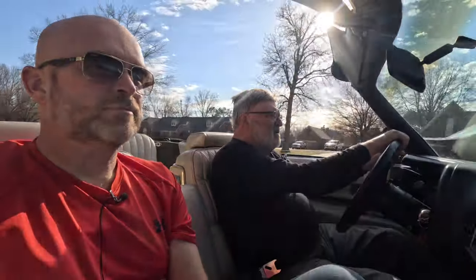Well, this does have smaller primaries than the Edelbrock, with big secondaries, but still, I would think that it would be... It's beyond that. Okay, so let's do one thing. Let's pull over and switch the distributor vacuum. I wonder if it's not getting any advance now. Huh, that's a thought. So let's pull over in the park up there. It feels sluggish, like it's not getting any ignition advance. Yeah, I bet you that's it. Okay, let's do that.